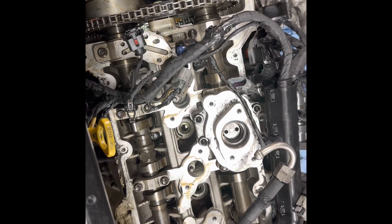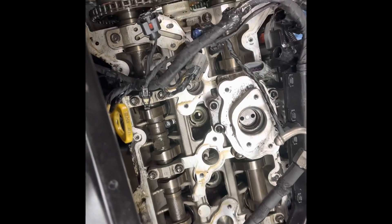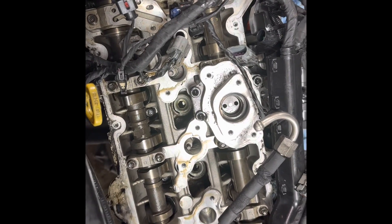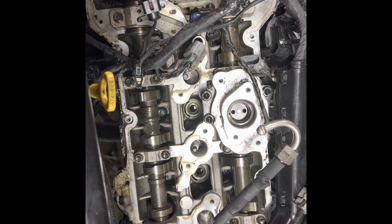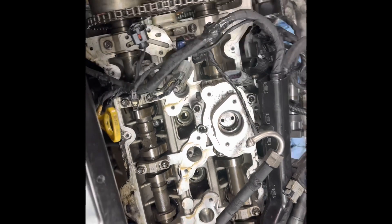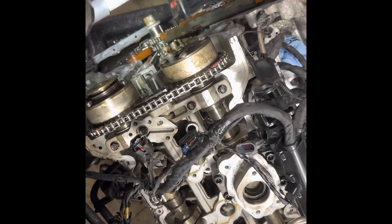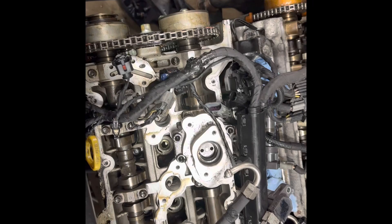The main thing is that the cylinder head bolts held — they're known to strip out. It's an aluminum block with crazy torque specs: you torque them to 30 foot-pounds, then 122 degrees, and then an additional 90 degrees. So it's got some torque on them. Those all held, so we're good to go.